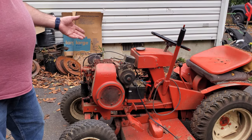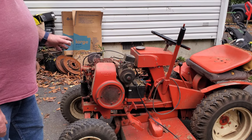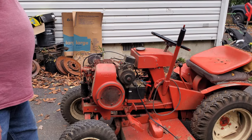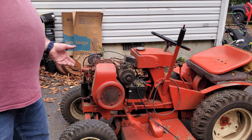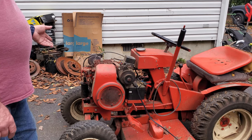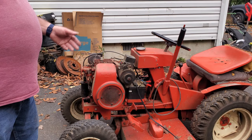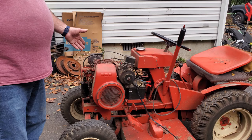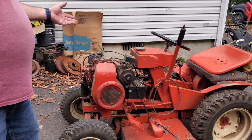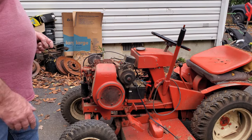This is basically how I go about seeing if something's going to run. The carburetor does not need to function for it to run, or even to start. The only thing you need the carburetor to do is control that throttle plate so you don't get too much fuel and air and have it run away — that's the only thing the carburetor needs to do to see if the engine will run. That's one of the last things you want to worry about, because if there's something else keeping the engine from running mechanically — it could be valves or a bad cam — there's no need to waste your time rebuilding the carburetor before you know if the thing is even going to run. You want to make sure you're going to be able to get to the end before you do too much work to it.